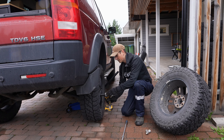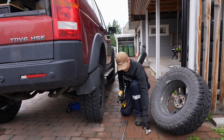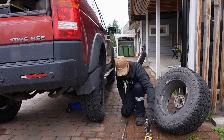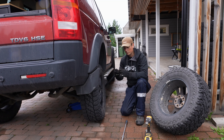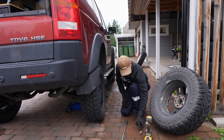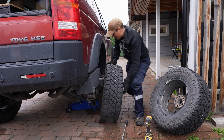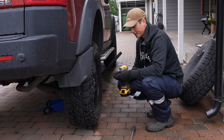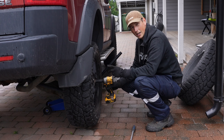If you're wondering why I'm not using the impact wrench to finish the lug nuts, it's because they have an aluminum outer shell. If you use the impact wrench too much on them, they're going to be ruined — they swell up because they're not sealed, and the inner part expands and ruins the lug nuts. Also remember to use the torque wrench at the end.